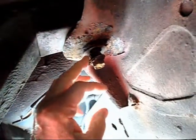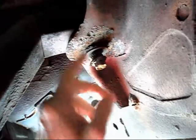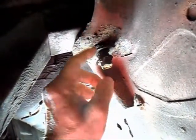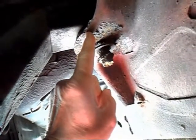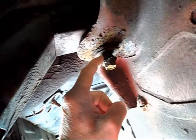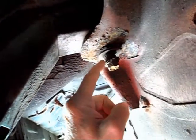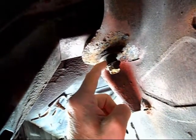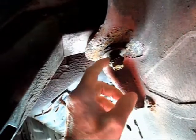Getting back to this rear one here, which is easier to see — you can't just stick a hockey puck in here. You need a heavy washer on the top and the bottom, and you need some rubber underneath, then a washer. But you've got this shaft. If you don't insulate the shaft from this metal, when it goes up and down it's going to make a squeaking sound like it does now. So when you replace this bolt, you probably have to put a piece of garden hose over the bolt so it acts like an insulator between the bolt and the side of this metal in this elongated hole here.